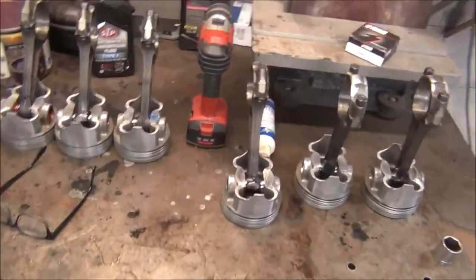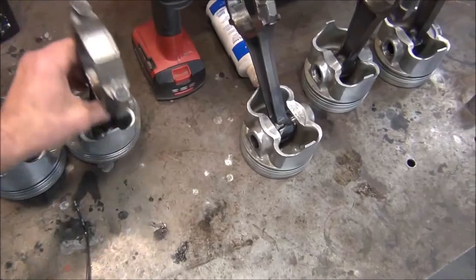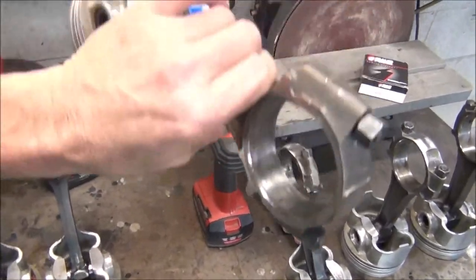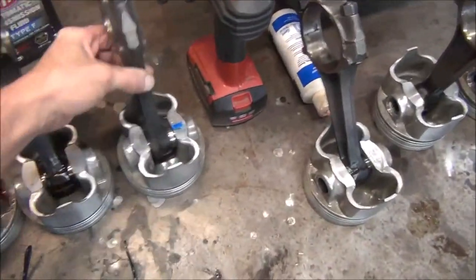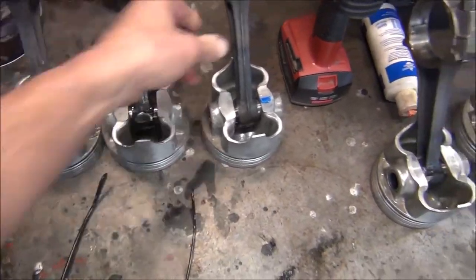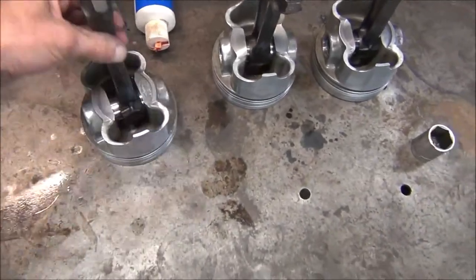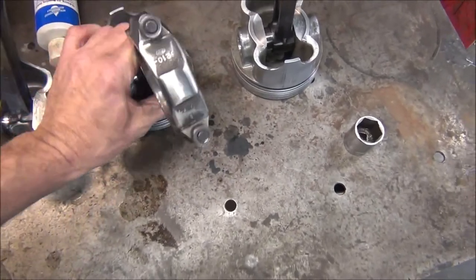Not sure if I mentioned it, but I did see something I didn't like when I tore it down. These wrist pins are about how they should be. Right now the grease is a little cold, but you can move them nice and free. These two were already about right. This one I've already fixed. That one isn't too bad, but these are just too tight.